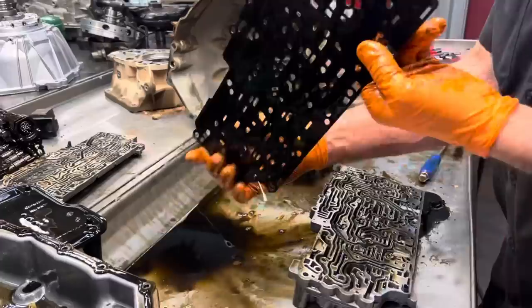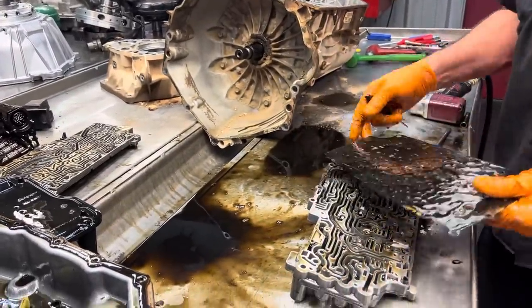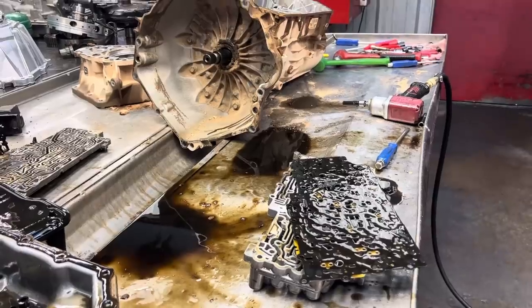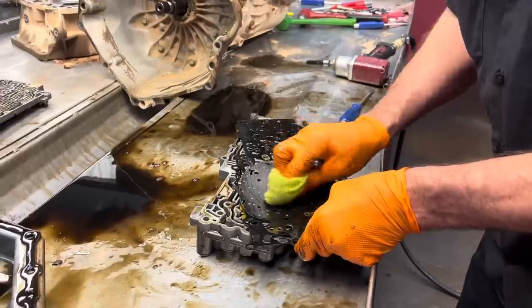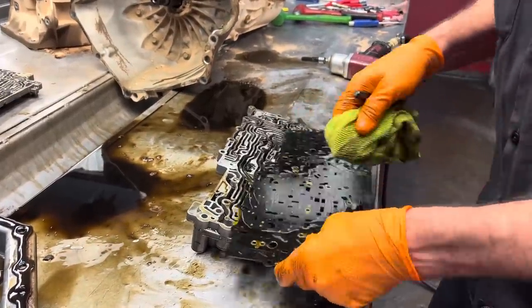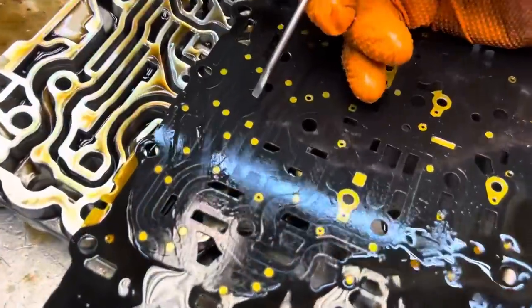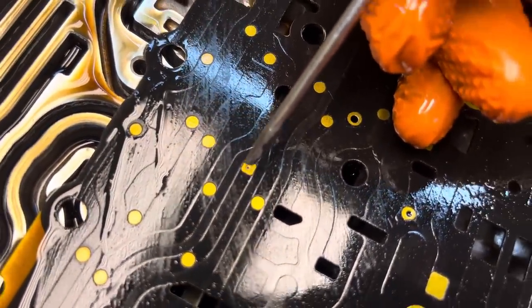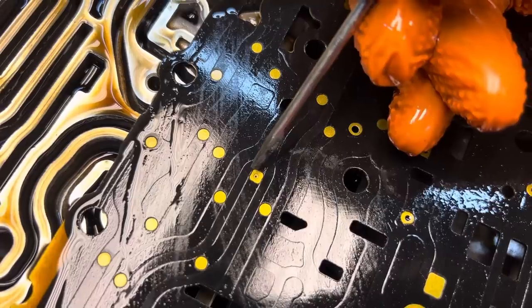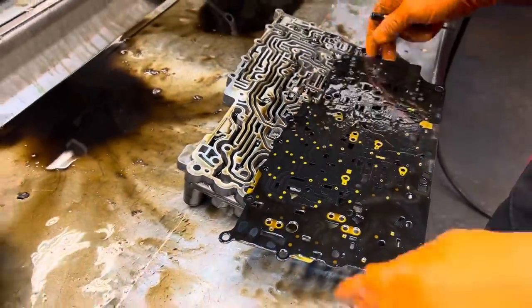and you've got your valve body plate here. Really don't ever see much wear here, but we do have some information on some things that are going on with this plate right here that we wanted to get everybody's attention on. Everybody's starting to show this problem. We saw it in a meeting a while back. You can see this hole right here. It's probably 11 thousandths. I mean, it's tiny. And plus the machine that made the plate beat the hole up so it shrunk even more than it's supposed to be. So just drill this hole out to 30 thousandths and you'll be fine.